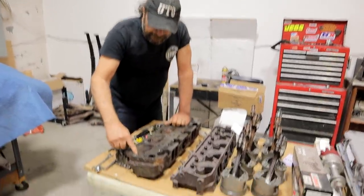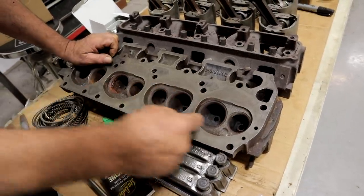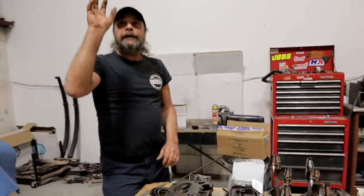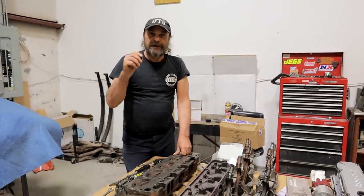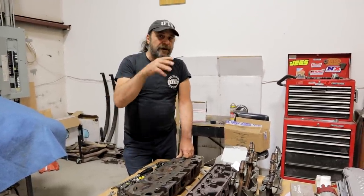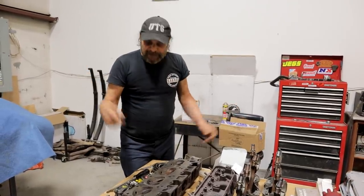Here's another example — these chambers aren't always exactly perfect. As machined, sometimes they're a little off and will hang over a little bit. You would put the cylinder head on the block and then from underneath see what parts of the combustion chamber may overhang the cylinder. At that point you would want to dress those down so you don't have any sharp edges inside the chamber that can lead to hot spots and detonation. It's little things like that that make a huge difference in not only the performance but the longevity of the engine — a sharp edge of the combustion chamber overhanging becomes a glow plug, and it can tear your stuff apart.